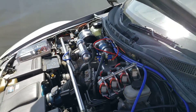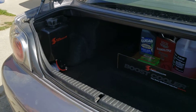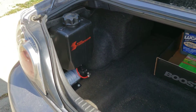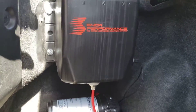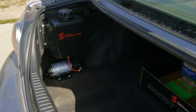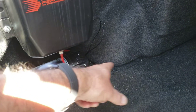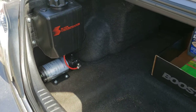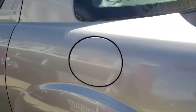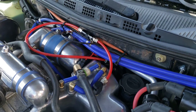We'll take a look at the trunk — that's where I mounted it all. All the wiring is back behind the carpet here, runs down through a grommet, and then underneath the car following along the fuel rail all the way up to the front. So just three wires running up there along with the actual meth cable.